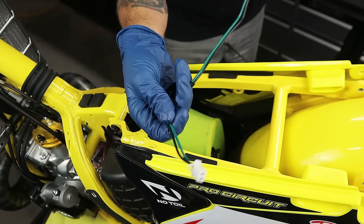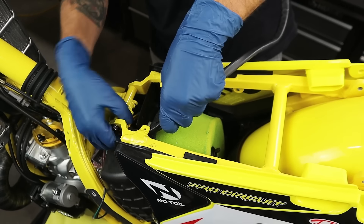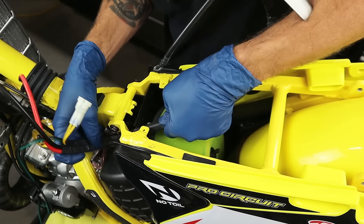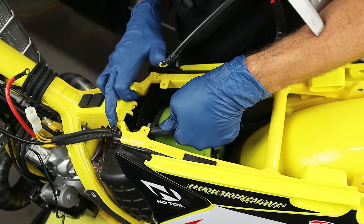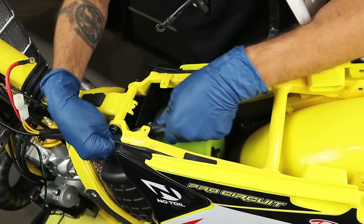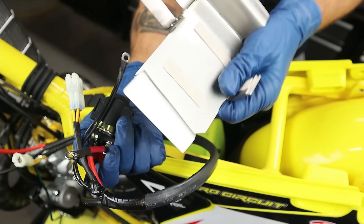Let's lace this through the bike. I'm going to start with the longest — basically the magic button wires followed by the negative cable followed by the positive cable. I might have to arc it around to get it to pop out where we want. Now we can drag this thing straight out — there'll be some more routing down toward the starter and the handlebars. If you want to open your airbox hole a little more, you can — that'll give you more ease of pass-through. You can also pull the relay off the battery tray so it's not swinging around hitting you in the legs.